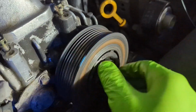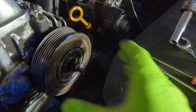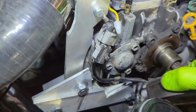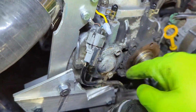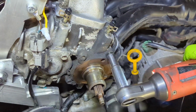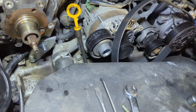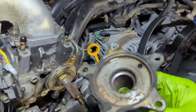I might have that clutch start slipping. I might notice that I need to run more power through that electromagnetic coil in order to maintain the right boost pressure. I wanted to find all of this before I went through the effort of upgrading the fuel system, so that I could start fixing these issues sooner. So here you'll see me actually replace the pulley, take it out on the road, and actually see what boost pressure I'm making with this new smaller AC compressor pulley.